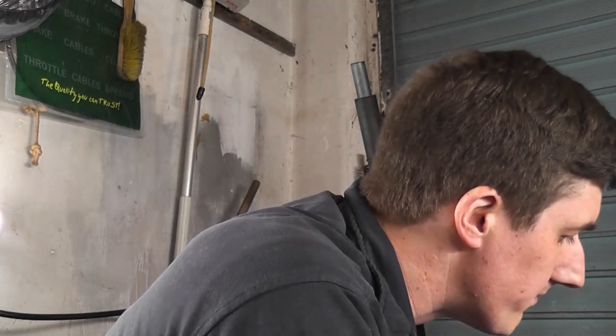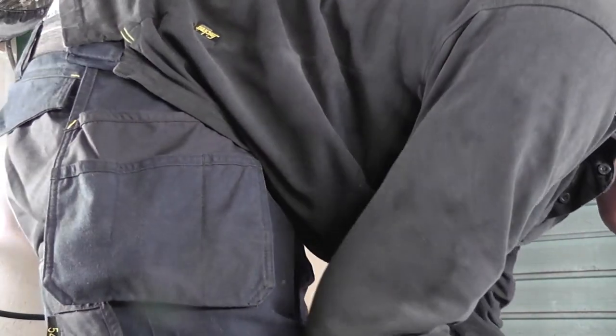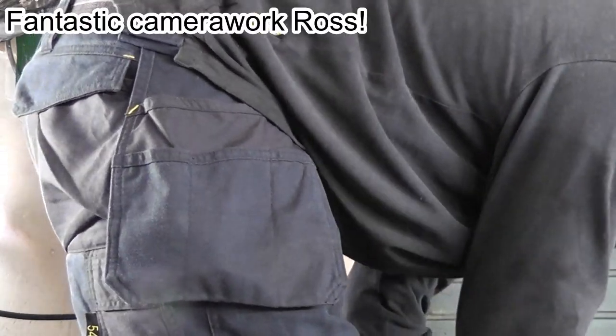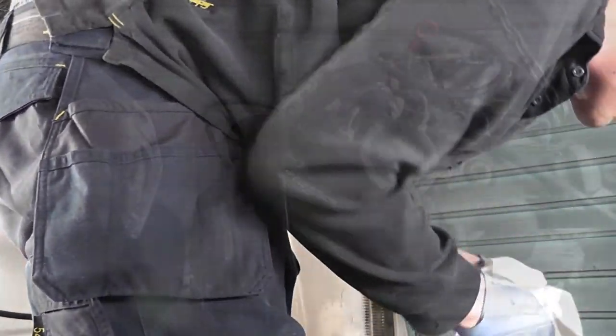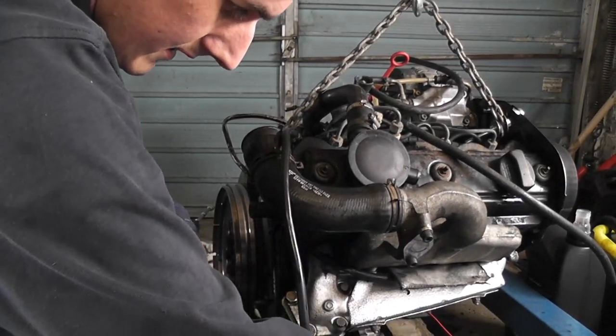But anyway, the upshot of it all is that it worked a treat, that trick with the bolt with the slot cutting it. So we now have oil up to the head. We've pumped it around the engine, and I put the sensor back in and pumped it some more, so I turned the engine over a good bit. So that means that everything in this engine is now lubricated where it needs to be. As I pumped it, the resistance on the drill got higher, so that was telling me that it was doing its job. So okay, things are looking a bit more positive today. So this is how we're looking.